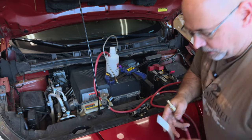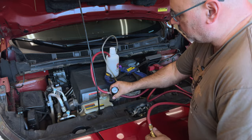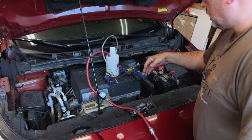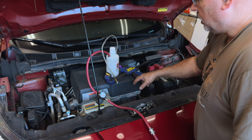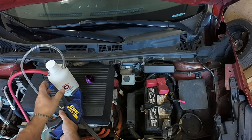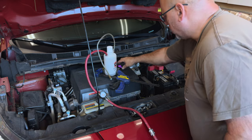I have this fitting hooked up to my compressor at pretty high pressure, but with the regulator backed right out it's showing zero PSI. One of the things I don't like about the Speedy Bleed or any of these systems is that they topple easily, and in the engine bay it's hard to find a flat surface. This Nissan has a nice big vertical surface. I just use an Irwin clamp and gently grab onto the bottom — that just keeps it from tipping over. That's kind of a hot tip.